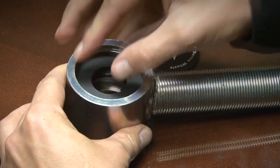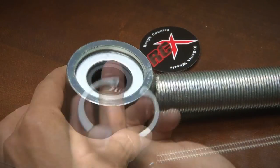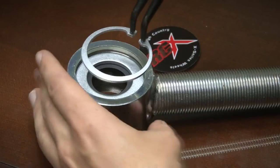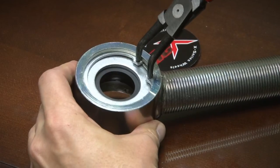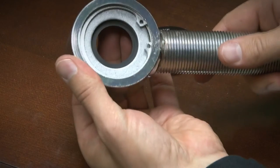I like to start on the snap ring side of the joint housing. First, I press that bushing in past the snap ring groove, install the washer, then using our snap ring pliers, we're going to compress the snap ring and install it into the X-Flex joint housing. Once that snap ring pops into place, we'll make sure the washer and the bushing are secured against the snap ring.